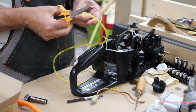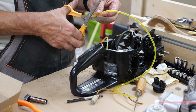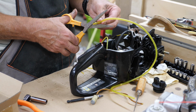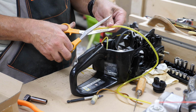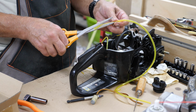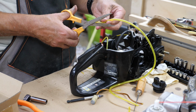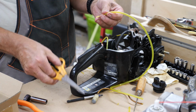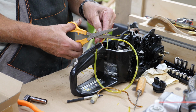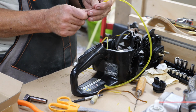If you got the real cheap made in China Hayscale kit. So what you need to do is cut a very long taper on the hose. The best thing to do is go get your wife's good scissors. You need a pretty long taper on it too, because you got to have enough hanging in there so that you can reach in and grab it with either forceps or needle nose or something like that. At the very tip, I actually cut a point on it. Makes it a little bit easier to get started there and grab.